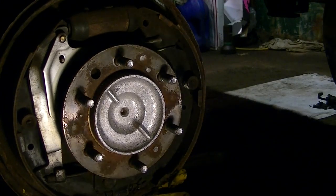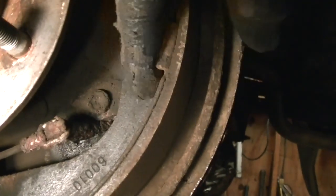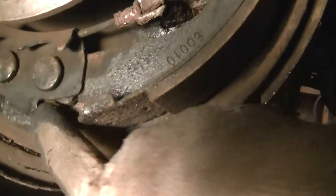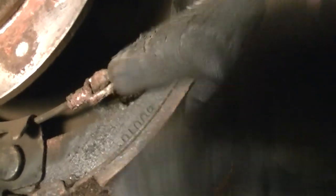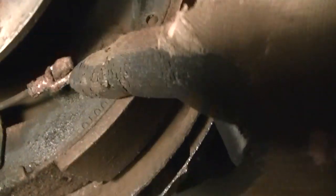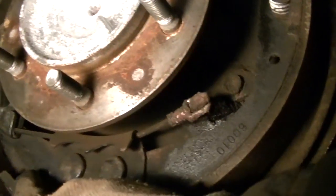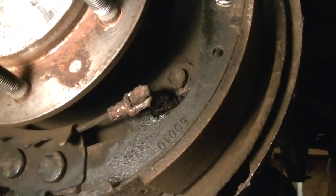Here's what we've got to take off. We've got a half-inch bolt right here and there's another one right behind this shoe. We'll take a pry bar and pry the shoe back a little bit because it does have a spring that will release, and this gives us enough room to get the bolt back there. You can see there's a bracket that runs the cable from the front of the shoe all the way back to the bell crank, and that's how your e-brakes work.